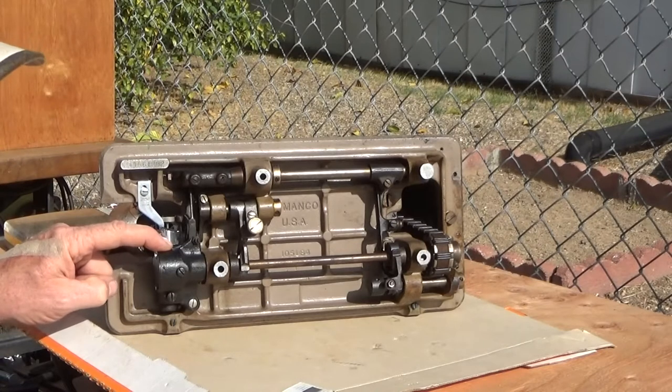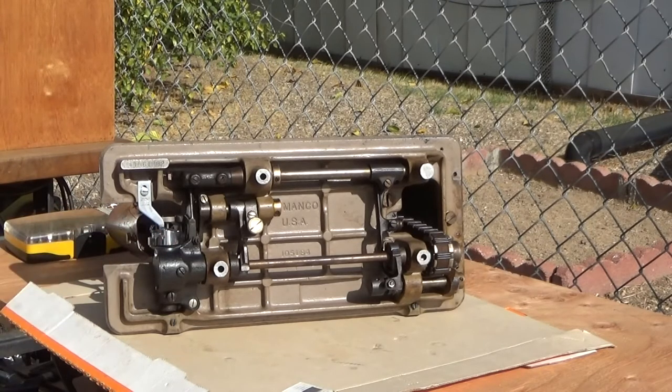Some people say you should use the So Retro grease. That particular formula has been optimized for use on Singer sewing machine motors. It has the right melting point, the proper viscosity. For that purpose, there is nothing better. But the more universal lubricant is called for here. I stick with the standard grease because that's what's available, and any modern grease is going to be an improved product over what was available when this machine was manufactured.